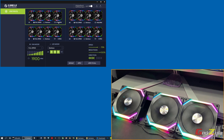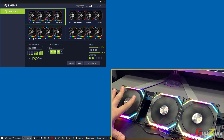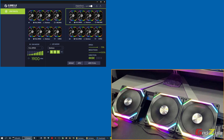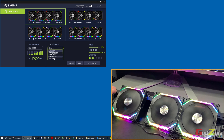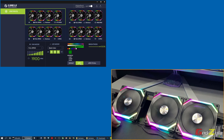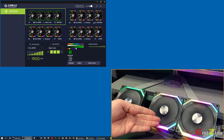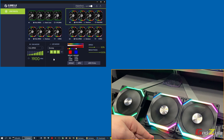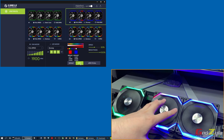Concentrating on L-Connect from Lianli — I've deliberately separated the fans into Set One and Set Two. If you want to change the ARGB pattern on Set One, you can just change it — for example, set it to static, hit apply, and it will only impact Set One, not Set Two. Likewise, you can change a different pattern on Set Two and apply it, and it will only affect Set Two.